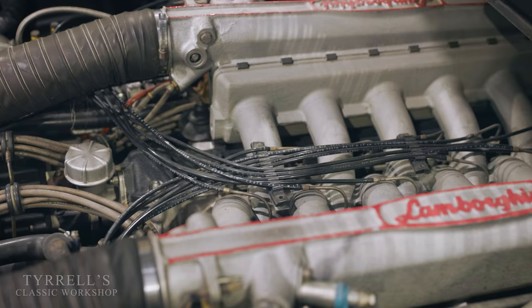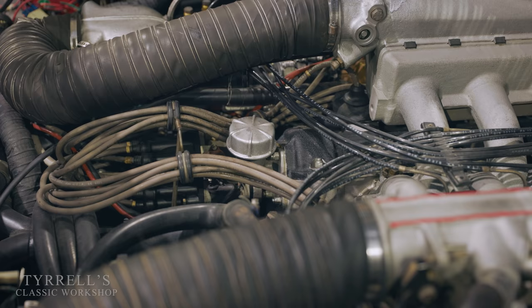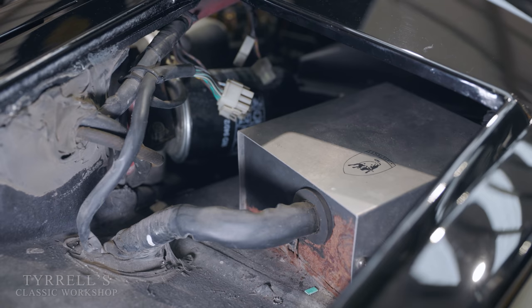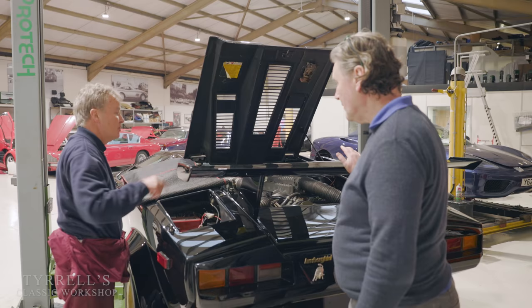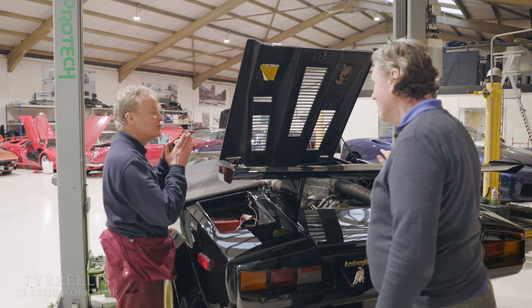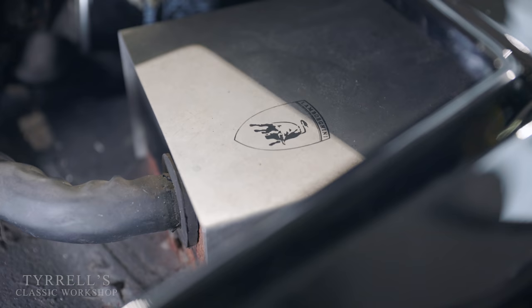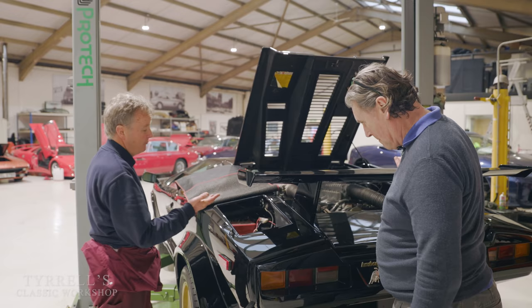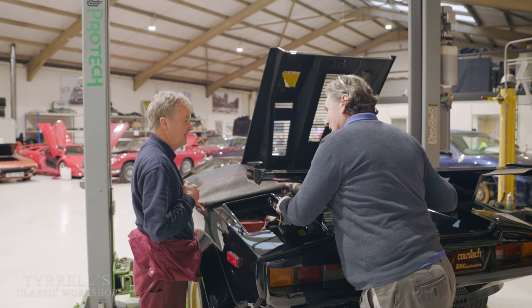It's more complex than the European ones because it's got two completely separate fuel systems and two completely separate electrical circuits controlling them, which is over here and over there - unlike the European ones where it's in the boot. So it took a bit of time fathoming out. Once we knew we had good pumps that actually pumped fuel, it was work out how to get them to do that. We had issues with the electrical stuff just down to bad connections - a combination of age and water ingress due to condensation from standing. It's got three relays that control the fuel.